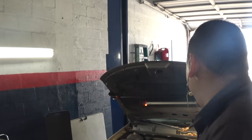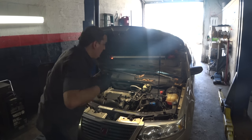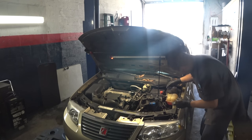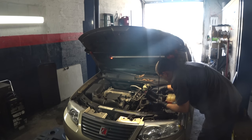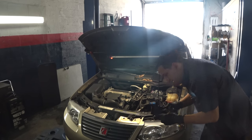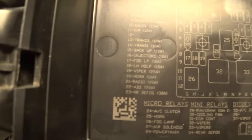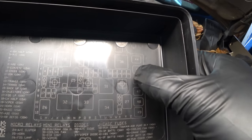We're going to sync to number one in-cylinder. I don't see a better way to be honest. So we're going to disable ignition and injector pulse. Hopefully we have an injector fuse we can just remove. Injectors fuse is number 16, 10 amps. Let me bring you closer so you can see it — there it is, number 16, 10 amp injector fuse.